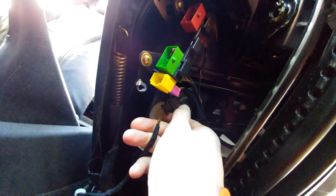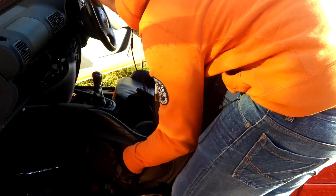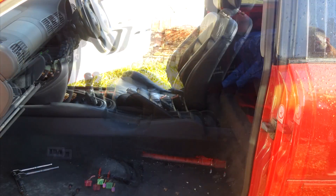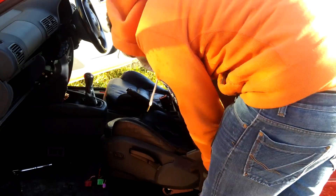I've been a bit rough here pulling it off — just use a screwdriver to pry it off a little bit, but be careful not to snap the tabs. Now the seat isn't being held in place by anything, so we can pull it out. Just be careful — these seats vary in weight. The original A3 ones are quite light, these ones are slightly heavier, and Recaros weigh quite a bit more.